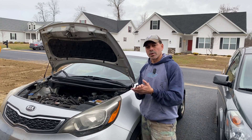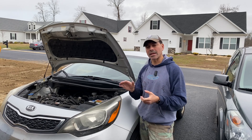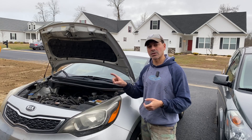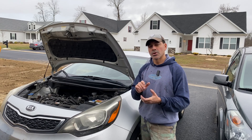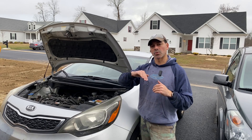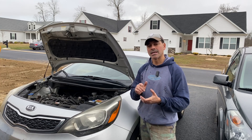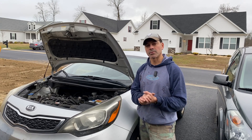If you're wondering how we got to this point: we replaced the upstream O2 sensor after getting a code for that, and then we were getting the P0420 code, which pertains to the catalytic converter. The catalytic converter had been replaced — I'll have a link to that video in the description. After that was done, we're still getting the P0420 code. A lot of times that pertains to the downstream sensor, but you want to run live diagnostics. Usually your upstream O2 sensor is more erratic and your downstream is more stable. I'll also have a link to a video explaining O2 sensors in more detail. We've diagnosed it as the downstream, so that's why we're replacing it.